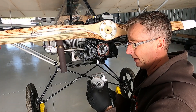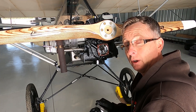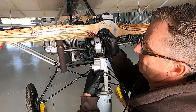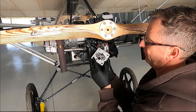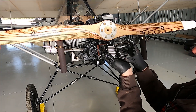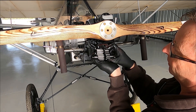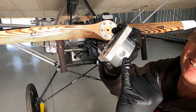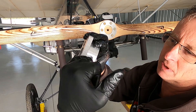I'm going to take the new pump body apart and make sure I can pop it in for a test fit before I extract the studs, because the studs won't be long enough to accommodate the high-flow pump. You'll be able to see the depth difference between the two pump bodies — it needs to come out further, so I need longer bolts. The new pump is obviously thicker. Let's do a comparison of the gears — original gears here, high-flow gears here. Big, big difference in the amount of oil flow that's going to be pushed through. Nice smooth bend on the inside instead of an enormous jagged right angle.